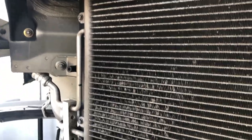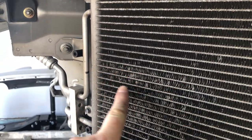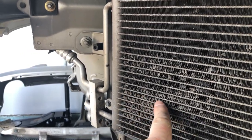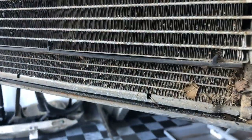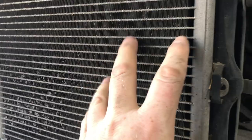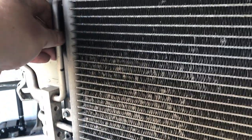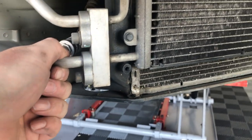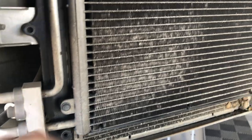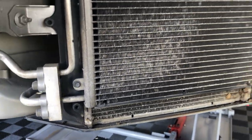Here's the front of the condenser. It doesn't look like it's in too bad condition. You can see this is where the condenser gets the most exposure to the outside elements — a number of the fins have been sort of pushed out of shape, whereas up here towards the top they're all still perfectly straight. Crap and crud kind of gets anywhere, so I'm going to get the brush in there and the vacuum cleaner to get that cleaned out. I can actually take this front piece off — it slots in here and there are a couple of 10mm bolts that will allow me to take this piece off, but they're also connected here to the fluids, so I'm going to leave them as they are. At the very least I can get the crud out from the side. They look like they're in pretty good condition; I don't think these are going to need to be replaced.